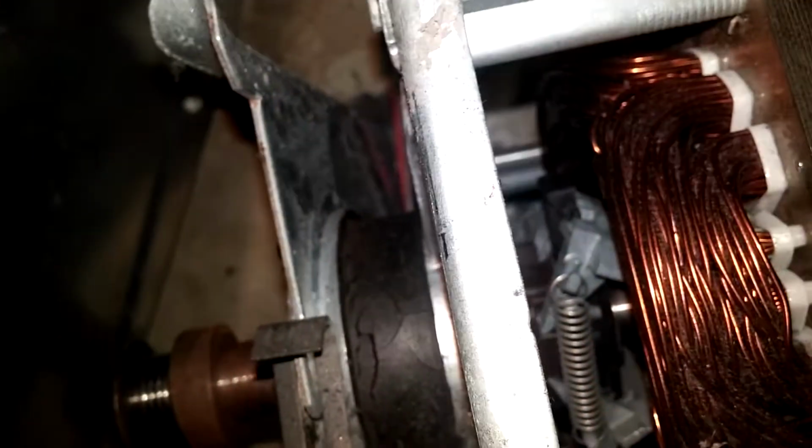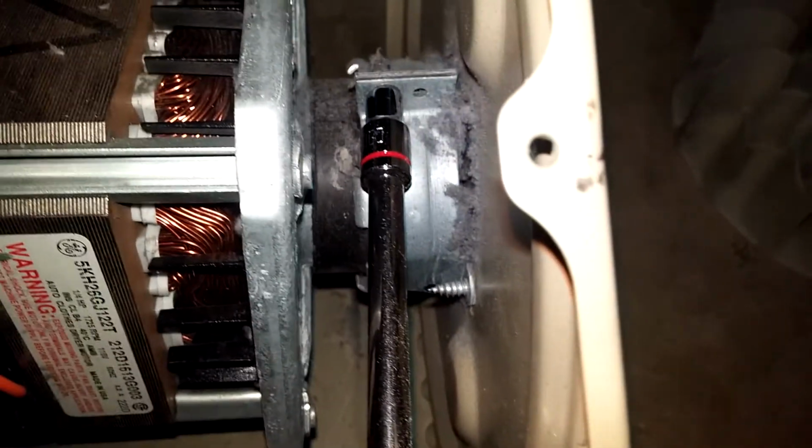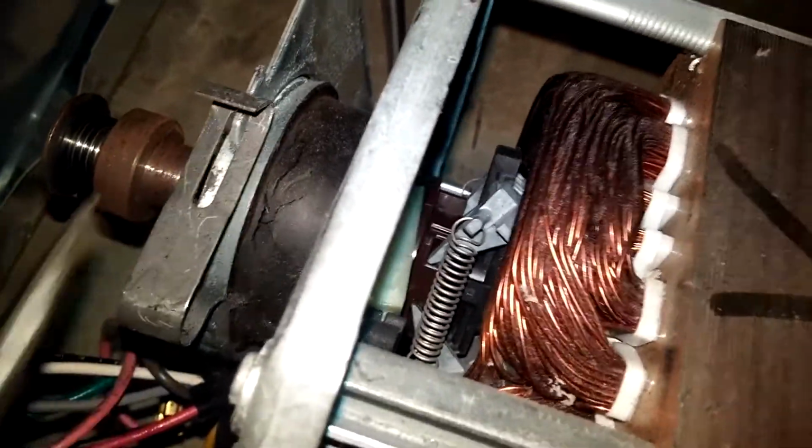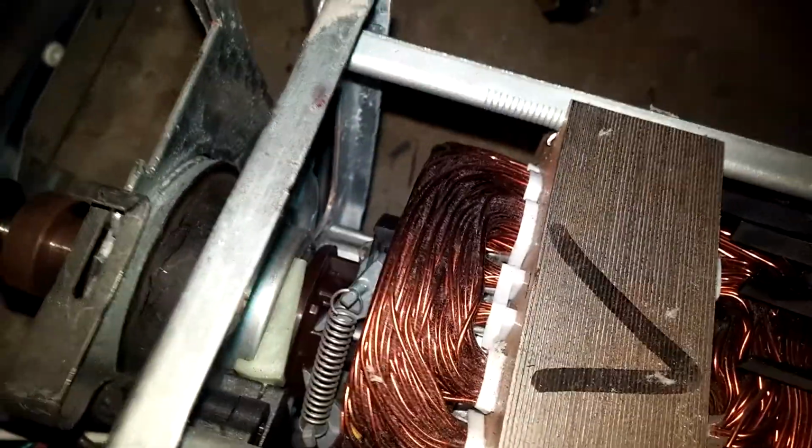Now you need to disconnect both of the motor straps and remove the old motor from the frame. On the fan or turbine side, loosen the top screw and then completely remove the bottom screw. The left motor strap you need to disconnect with a screwdriver.